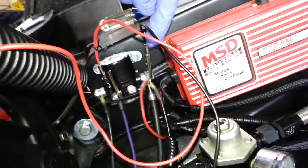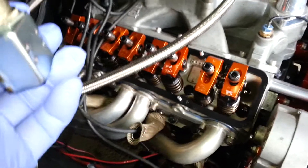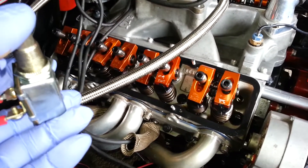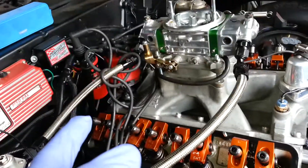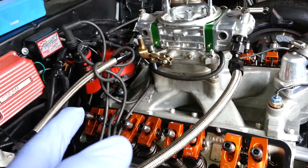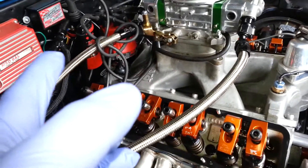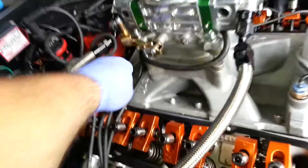This is just your power source for ignition, so when I push the button it's going to cycle through power, setting the valves — everything's loose now — to the other side. Just push the button and it'll start bumping over, sending power down to the starter. Make sure on that HEI back there, the distributor, the MSD — the ignition box and the coil and everything — it's disconnected from the source. You don't want this thing to start up on you.